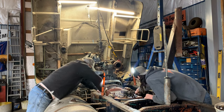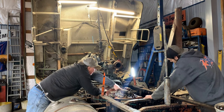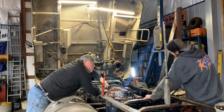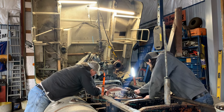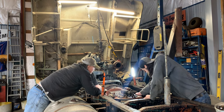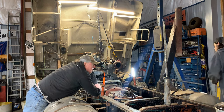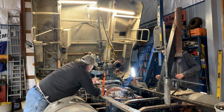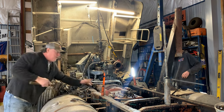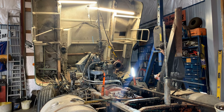So why don't you think it will come off when you pull up on the engine? Because there's a washer that's stuck to that bushing on the bottom. It's going to pull it right out of square. This engine's got to be released from the chassis, and we're currently not. What they did is they used the wrong bolt, and they used the factory washers again. Here, look, I got this one out. This fine thread is the right bolt. They used the wrong bolt, because that was coarse thread, and it was not a nylock. So that's the problem, 100% guaranteed.